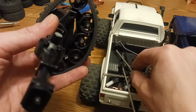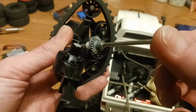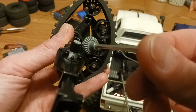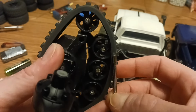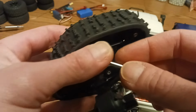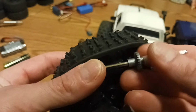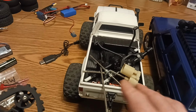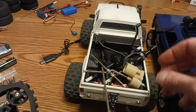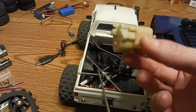But here's the WPL gear. This is like a powder pot metal alloy on a steel shaft. But they have these splines. And the splines can slip inside the plastic. And the splines make it impossible to slip gears on and stuff. It's so hard to get off. I had to cut the old ones off. Here's the original little 180 WPL transmission.